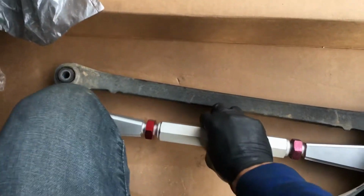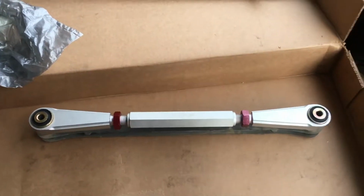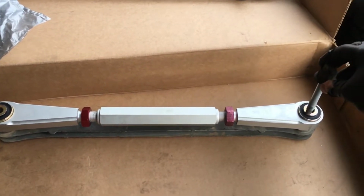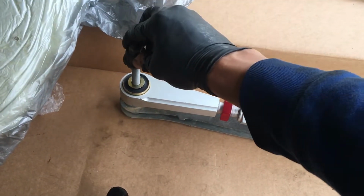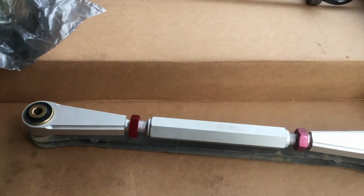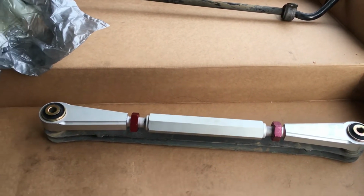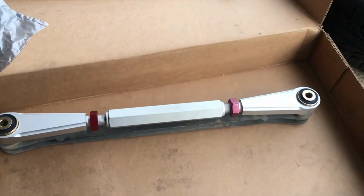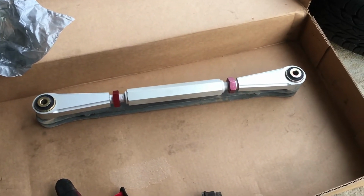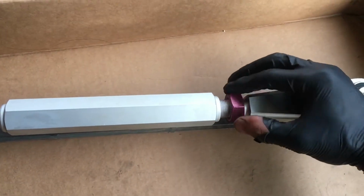As I'm turning this, these are getting further apart. Right now, it matches exactly. I put a bolt inside, it falls in. So I was actually at negative, I think 2.6, and the spec range was negative 1.4 to negative 2.1. So I'm just gonna tighten it a little. You guys couldn't see it, but I did tighten it. This is no longer aligned, and I'm just gonna tighten these.